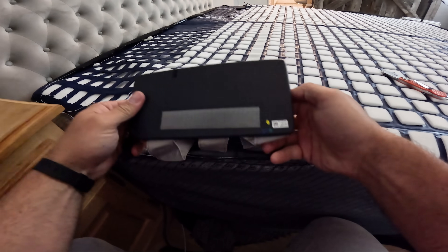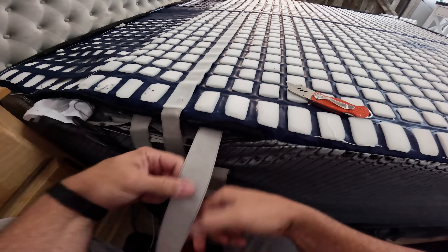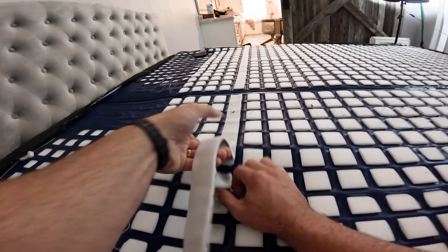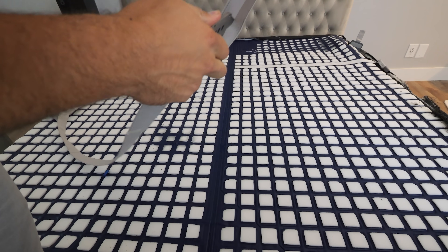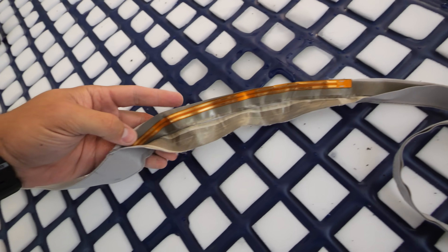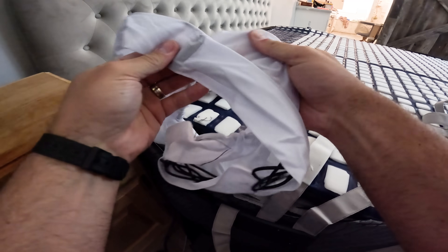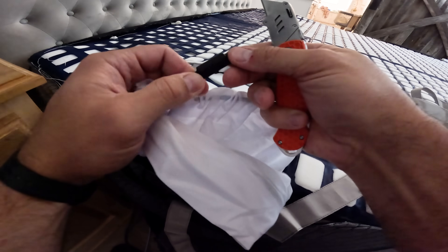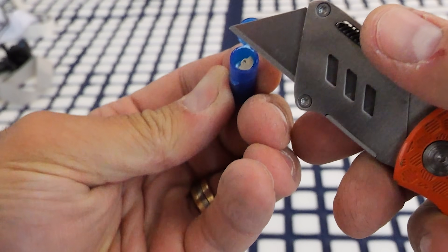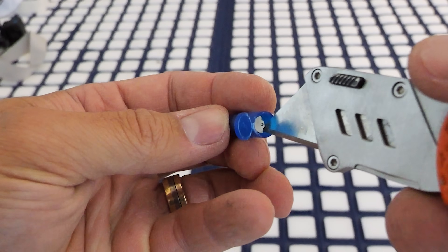The mattress has one electronic box on the right side and a larger electronic box on the left side, with some super long straps running through the mattress underneath the top pad. These straps contain the heart rate and motion sensors, while a bundle of wires above that around chest level contain the vibrators. The vibrators are a pretty sweet looking blue translucent cylinder — when sliced open we can see they're an eccentric rotating mass vibrator, like we saw inside old flip phones. They're super tiny, hidden underneath padding and sitting on top of a mattress, so unless this is a princess and the pea situation, they can't really be felt.